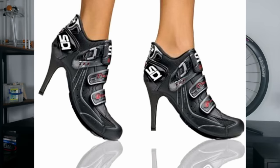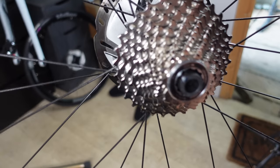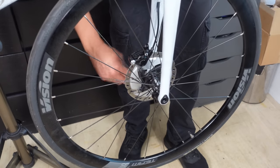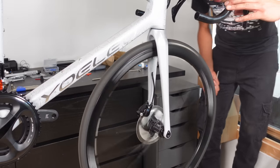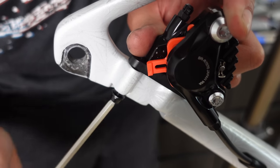Time for some wheels — the very essence of a bike's mobility. We added the new 105 cassette; the discs are already installed, but before the wheels find their place in the frame it's essential to grease the through axle. With that done the wheels can be installed. Now we can adjust the brake calipers — start by loosening the caliper mounting bolts, then pull the brake on and tighten the bolts. This simple action centers the caliper to the disc. The same process is repeated for the other side ensuring everything aligns perfectly with the disc. We also sourced the additional rear caliper mount we needed, so the calipers are mounted perfectly. That concludes part one of this build — check out the video where I cut this exact frame in half, which is quite insightful. Part two will be up next Sunday and the build should be complete if all goes well.